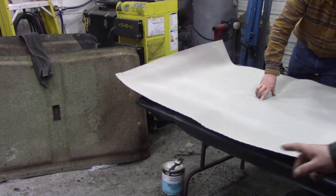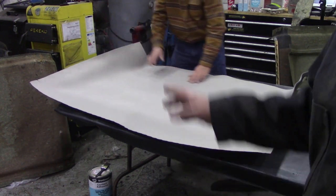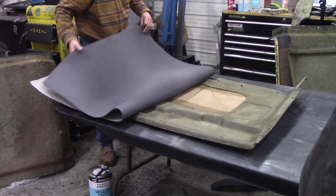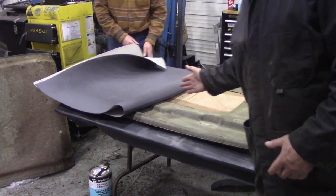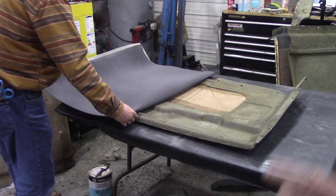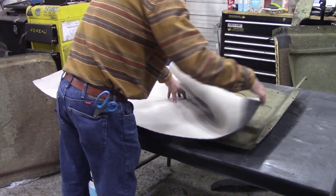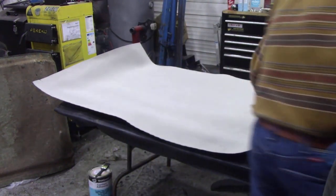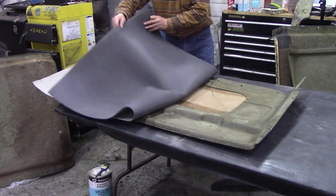The material is 60 inches wide. When we come to the middle panel we had a bit of trouble with the ends - it's really close but they drop into the gutters so you don't really see that. You've got to center it this way and also center it that way so that you've got a bit of overhang. Always cut it a little bit longer than you need, but 40 inches for the front panel seems to be right. We've got enough material, so we're okay.